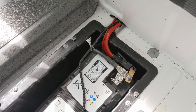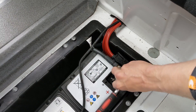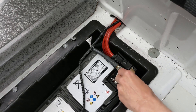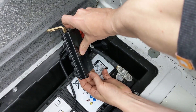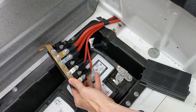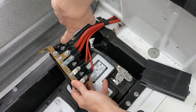We're in the battery compartment to install the Stirling battery to battery charger, so I'm going to take off this nut here — I've already disconnected the negative. Take that out, don't lose that nut. Take that cover off; hopefully you can see in there — there's a few fuses and some wires and handily a few empty spots as well. We're going to use this top one, probably just for simplicity.